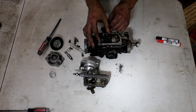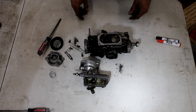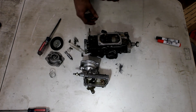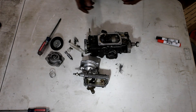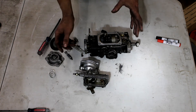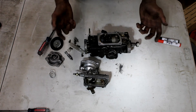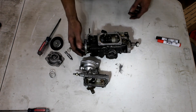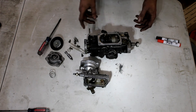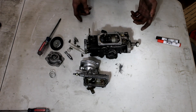The fulcrum lever is this right here. What the fulcrum lever is attached to is a collar that is around a single plunger system. We will probably go over the plunger system and the cam lift in the next video - we don't want to get these going too long. But we can go over what's happening in the distributor valving system, the cam lift, injection duration, and how the spill ports and plungers work in the next video.